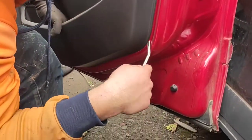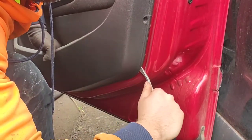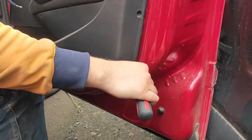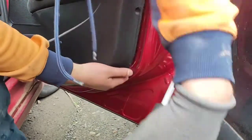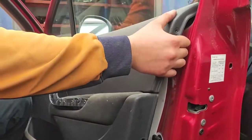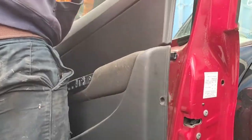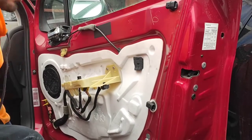For the next step I'd recommend using a hard plastic tool — I'm using a metal piece here, but I'd recommend plastic so it doesn't scratch the door. Basically all you're doing is releasing the clips on the inner part of the door trim to separate it from the door panel. As you can see there's a clip — that white one. When you remove the door trim, first pull the bottom part out, then slide it upwards to detach from the door panel. And this is when your door trim is completely detached from the panel.